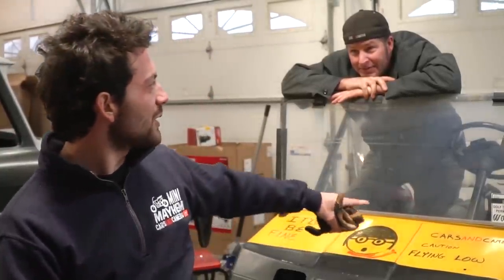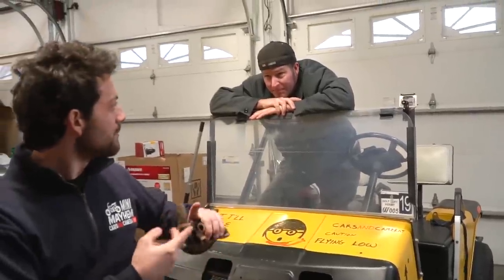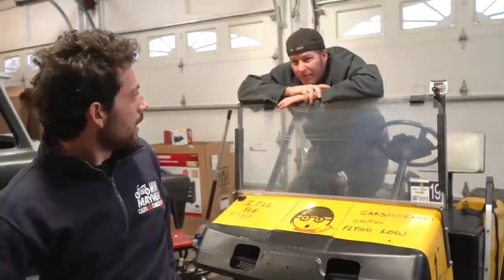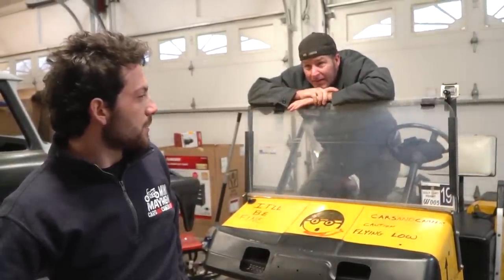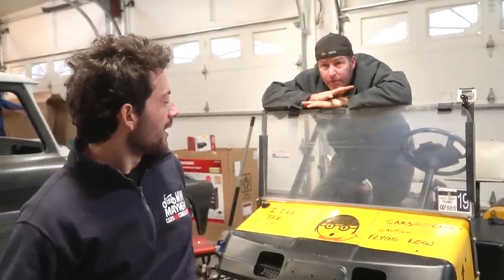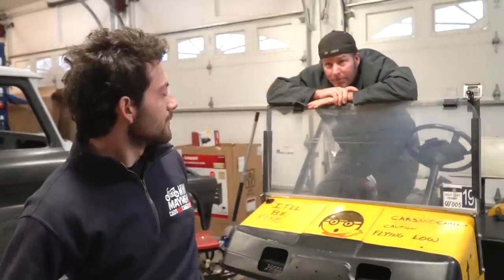What else should we do to the golf cart? I think we need to add a truck bed, maybe a couple drawers for tools and stuff. Making it faster would be cool, but with the steering the way it is, I think I'm fine with where it's at. And the gear change made a world of difference, too. It did. We gained 5 miles per hour. 2T, 5 miles an hour, low cruising RPM, just perfect, honestly. Perfect for around town, without busting speed limit laws.